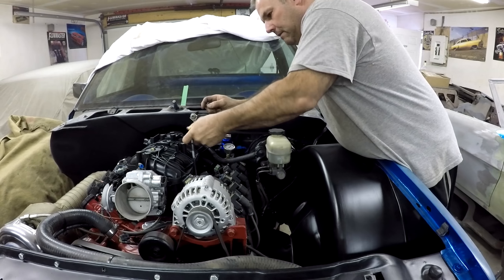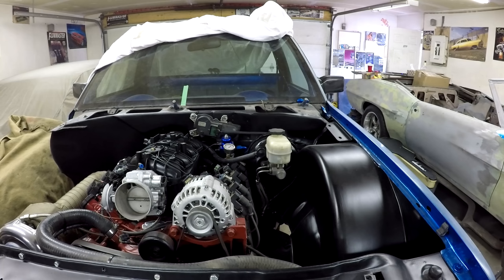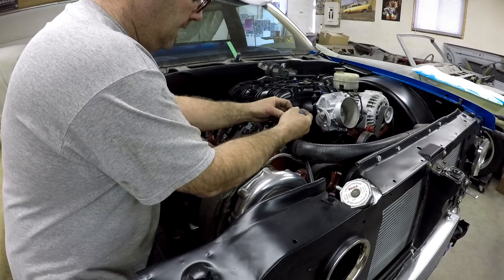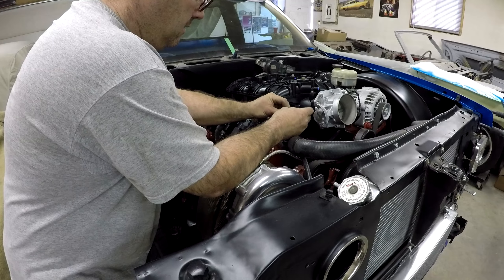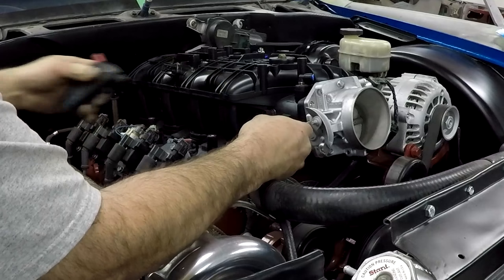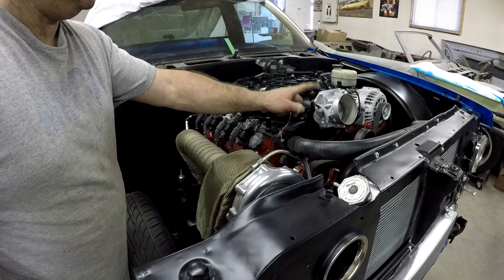The intake is on - I just have to torque them down. It says 89 inch-pounds but I don't have an inch-pound torque wrench, so I'm just gonna snug them up and crisscross the pattern. Problem with having the truck up on jack stands. Now I'm hooking up the intake air temp sensor - I already have the wires here, I just had to solder the plug on which I did, with some heat shrink. I guess I could just tape the wires or leave them - how simple is that. It just plugs in right here.